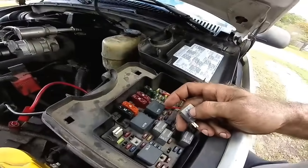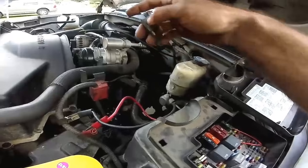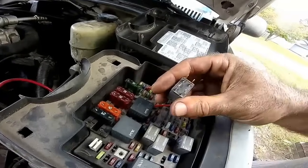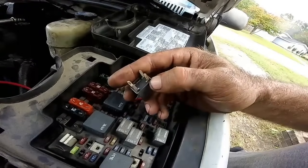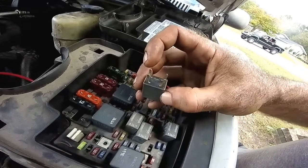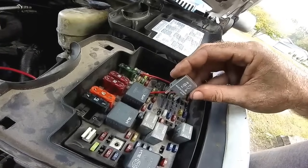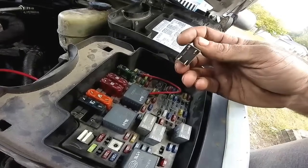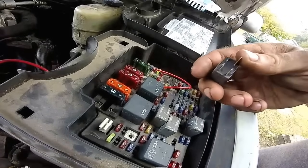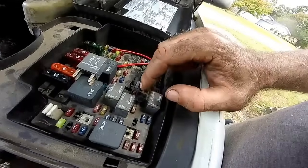One of 87 or 30 is going to be fused power from the fuse, and the other moves that power to the coil. Look on the bottom and find 87 and 30 — the numbers may differ on your vehicle, but usually it's 87 and 30. They're actually diagonal, so 30 is here and 87 is right here. We're going to connect these two.